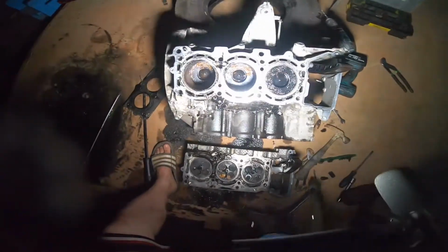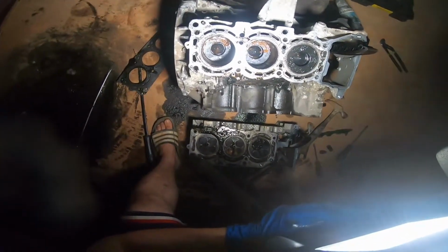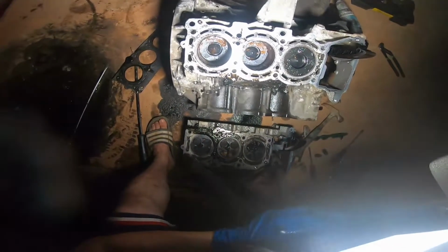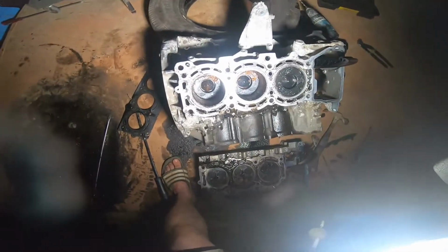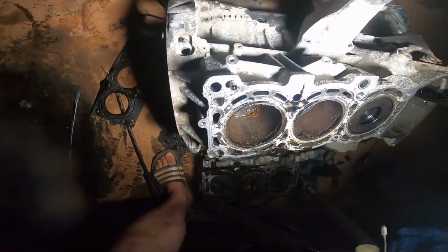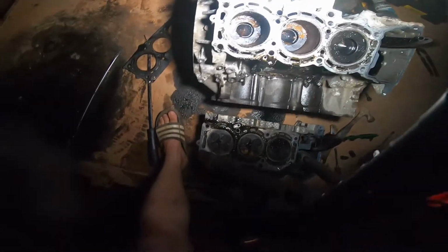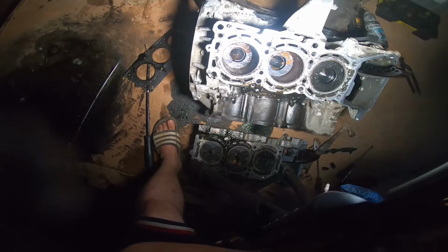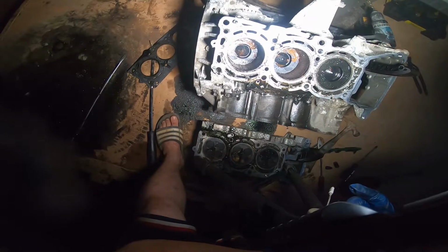This was probably parked somewhere, and somebody probably bought this engine. Somebody probably bought the van, which was flooded, I'm assuming, because that's probably how the water got in there, through the exhaust pipe and into the chambers. I don't see any apparent damage to the chambers. They have a lot of rust on them, which is obviously going to happen if there's water inside, and that's all I see. But I'm going to have to get these unstuck, and at this point I have some ideas.